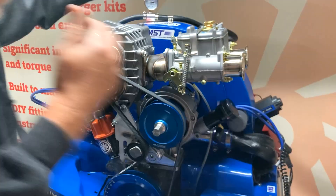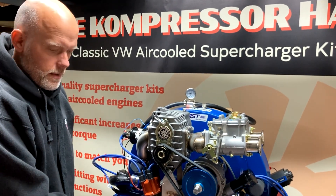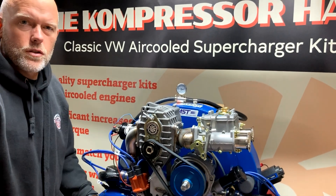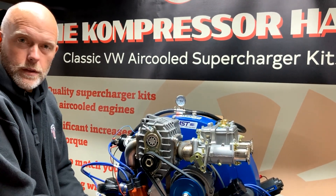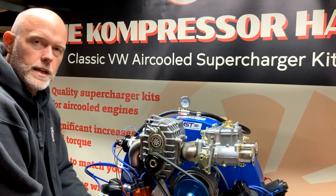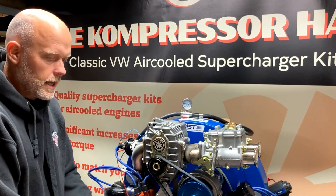While the engine was idling we've set the timing at 18 degrees, and what you've also seen is that when we rev the engine up beyond 3000 RPM the advance doesn't go beyond 24 degrees. That is really important — it protects your engine from damage due to over-advancing and becoming too lean.